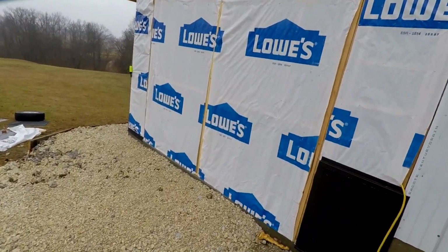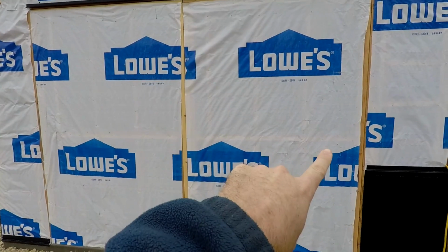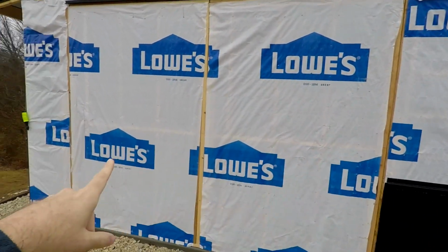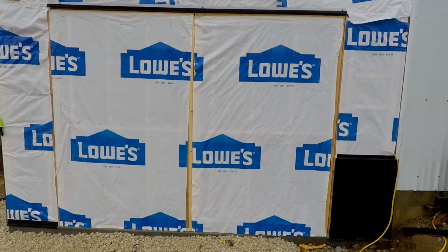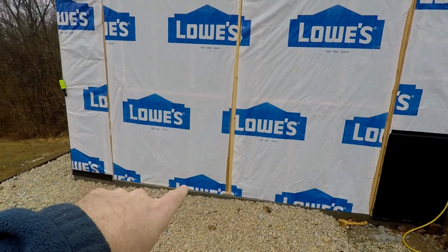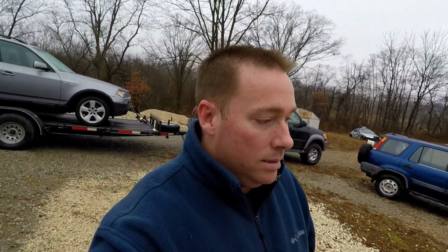So I had the doors, jump around the mud, had the doors all framed out. We're just gonna do a bifold, so I have a handle for each side. I have double hinges. I might go ahead and buy another set and have 3 hinges. And these would be faced with that redwood, and they'll swing out. I know they're not gonna operate absolutely perfect, and no matter what you do with wood, it's gonna sag slightly when you open them, but they're 5 foot wide, so it's a 10-foot door and 8 foot tall. Really not that big of doors.